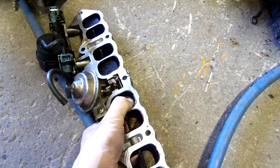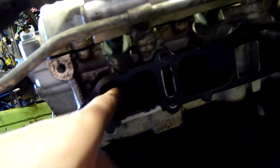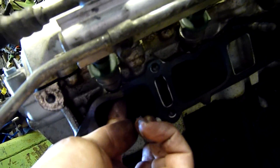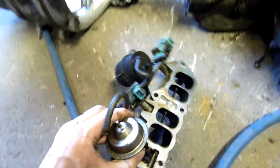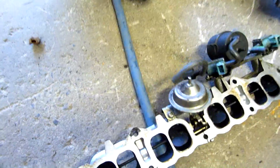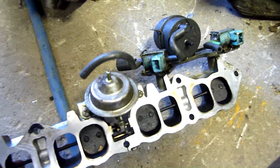It's only on the inlet. We've got two inlet ports per cylinder and the injector spraying right in the centre. You'll notice the injectors are actually mounted on the head, so the injector's up in here, and you're kind of halving or modulating your airflow with this T-VIS system. This is the one that I said has been known to drop screws down the intake — and you can see they're all still there, so that's a good thing.